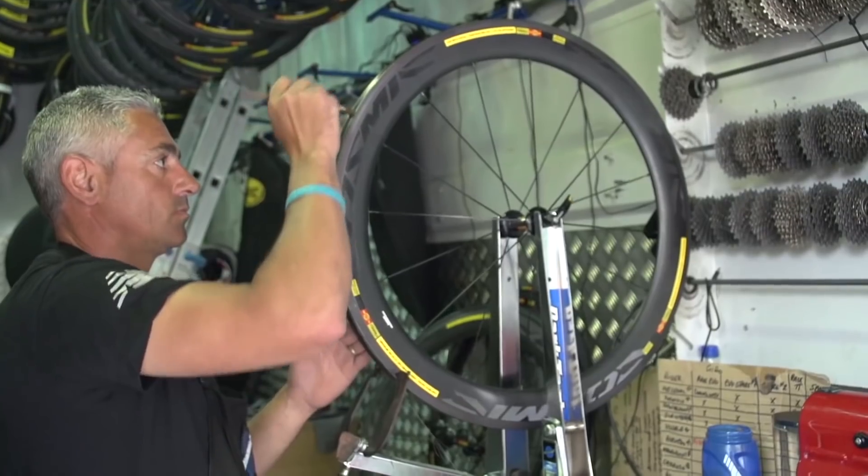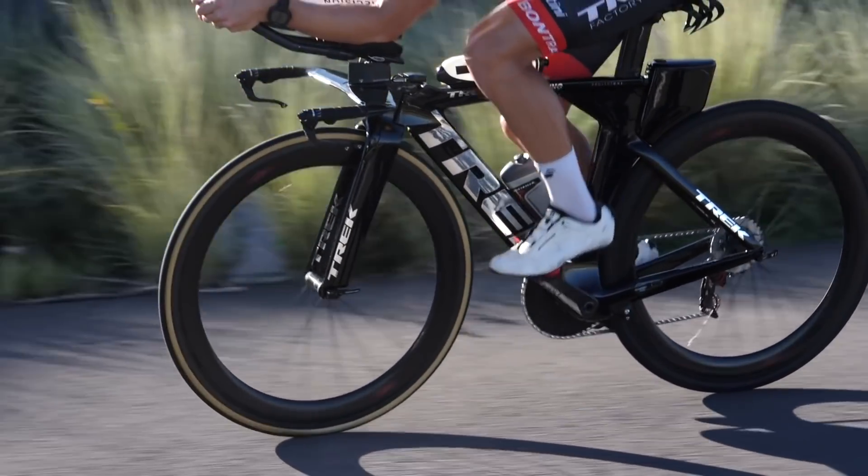Why use them? Believe it or not, plenty of pros still do, and there are a number of reasons for that. One of which being the weight, but more so in the actual wheel — because it's a simpler rim with less material, that saves weight. There's also a potential reduction in pinch flats, which is a big thumbs up, and it can allow you to run the tires at a lower pressure. Some also say they're better for cornering, though that's more subjective. There used to be an argument for rolling resistance too, but that's less of an argument now with advancements in clincher tires. Really, is it all worth it for a bit of saved weight and fewer pinch flats at £70 per tire?